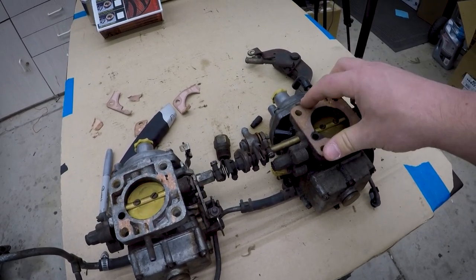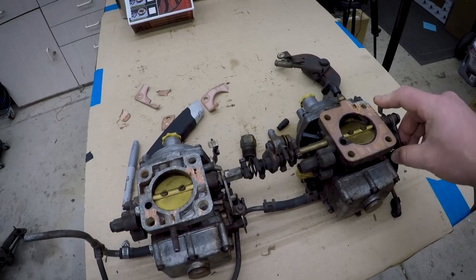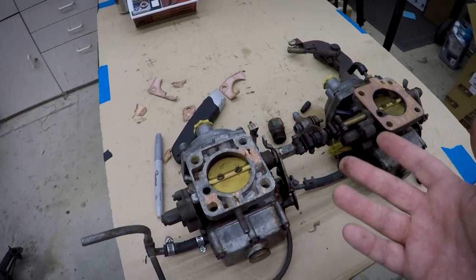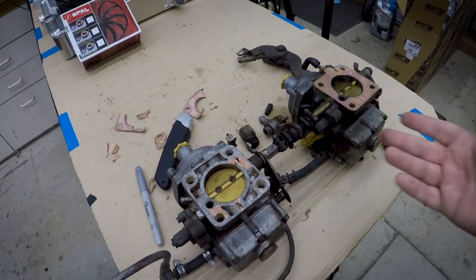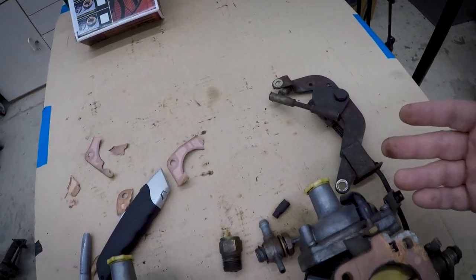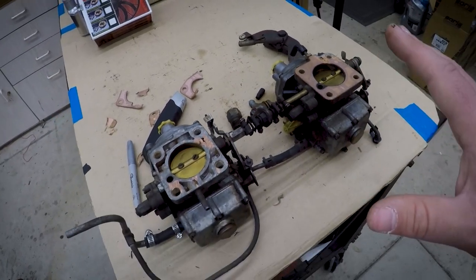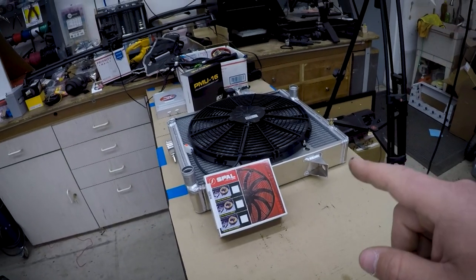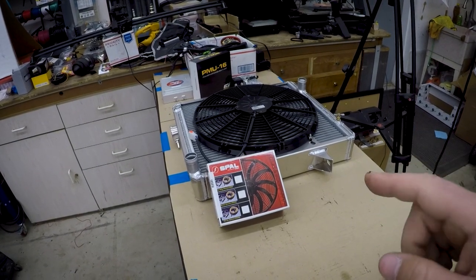The guts of them will be replaced with fuel injectors, which will be shooting the fuel basically straight at the throttle body. So other than incidental leakage that drains down here, they're not actually holding fuel, and they're definitely not holding any pressure. So there shouldn't really be any leaking issues, and tearing them completely down would be a much bigger headache. I will be doing the beautification though to also the linkages and other parts that are really gross, just because if the intake manifold comes back all nicely powder coated, these should be at least somewhat cleaned up to match. I won't be diving into that until I get the new electric fan and radiator off my bench. So that will be probably happening in the next video.